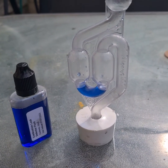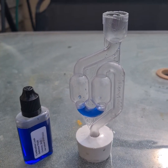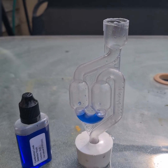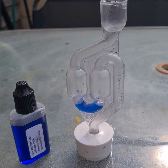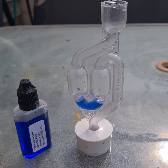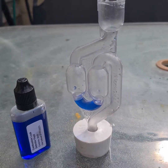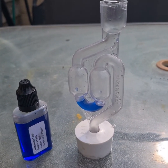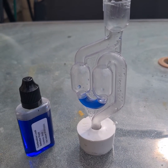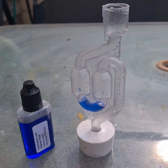We were losing coolant, but I have replaced the cap on the coolant reservoir tank. Because it is a sealed vacuum system on this mini, I think that may have been the problem. Also, one of the hoses — the overflow pipe going back to the coolant tank — was not sealed correctly, and air was leaking out there, which could have caused the system to lose pressure.